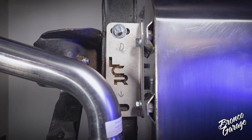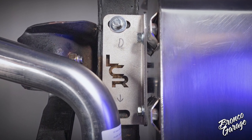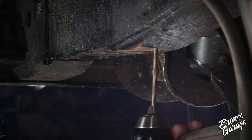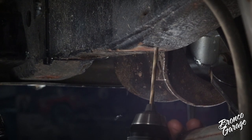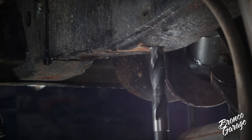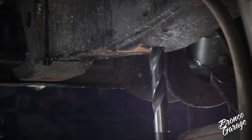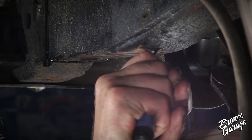Using the slot in the frame as a guide for the hole you need to drill, make sure the holes are centered in the frame. Use a punch and small drill and step up gradually till you get to the supplied half-inch drill bit, or use a carbide hole saw with a pilot and drill one hole. If you don't mark or drill the hole correctly, you may need to open the hole up to 5/8 inch. Be very careful while drilling to make sure the drill bit doesn't walk.